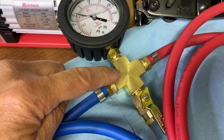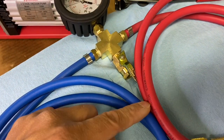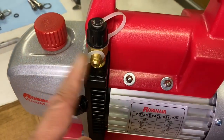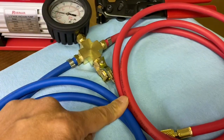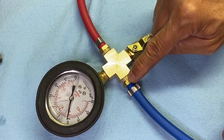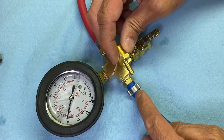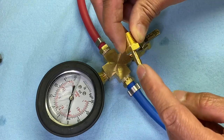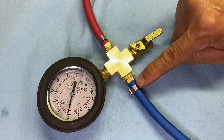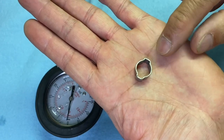I even bought this extra cover on it — the cover was six bucks. I had to buy this quarter-inch cross. And then there are a few adapters. I bought these hoses — these two hoses came with a set for some AC hoses. I wanted to use these because that's the connector that's on the vacuum pump. I couldn't find that particular piece, so I just ended up buying these. The hoses were fairly cheap, and they already have the right pieces on there. To get my hoses to attach to this cross, I use an adapter. This barb is what goes into the hose — it goes into this side right here. The barb is 3/16ths, and on this side is a quarter NPT male, and that's the part that fits into the cross. To attach the hose to the adapter, all you have to do is put this cinch clamp on it.